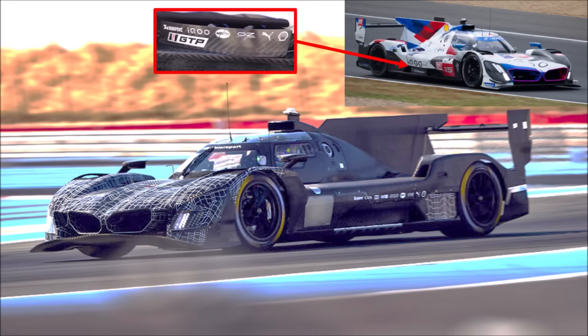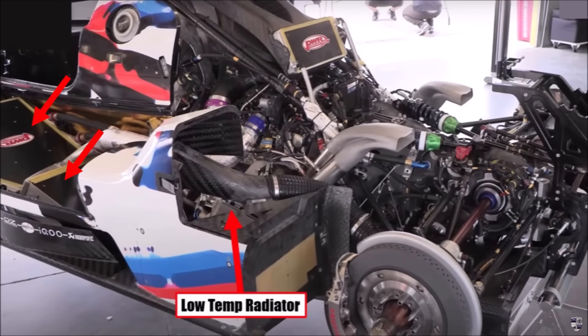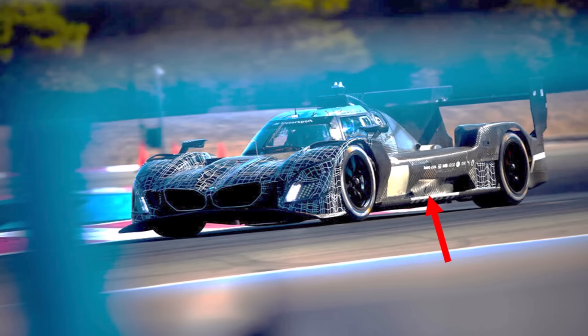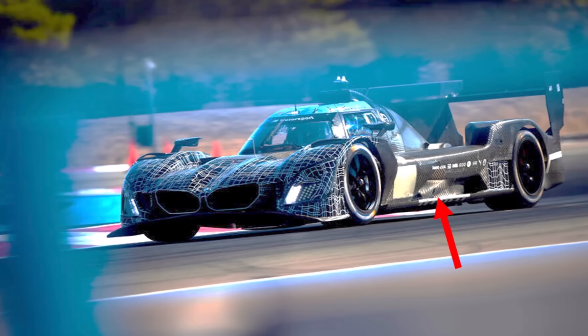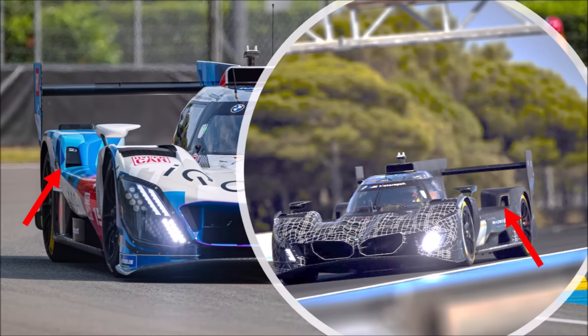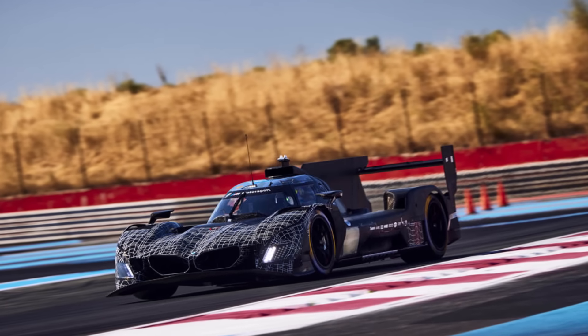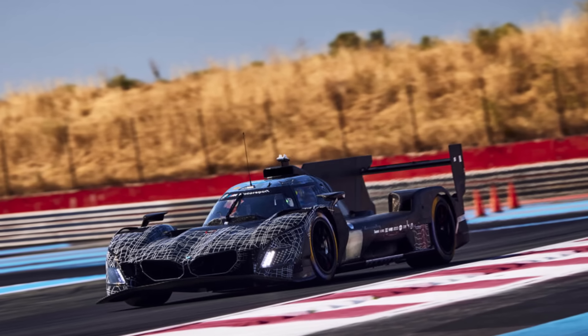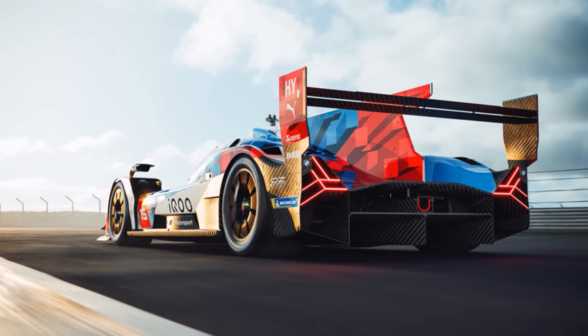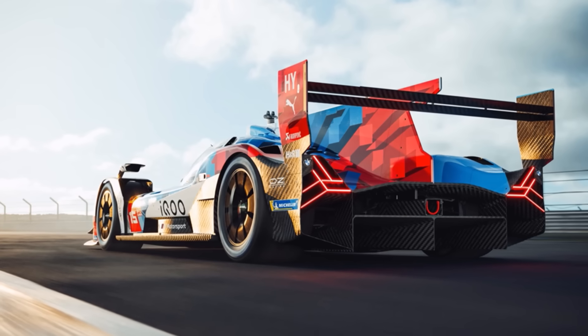A bit further back we see a change to their side pod. The large air guide is gone and there is a clear view on the inlet for the rear low temperature radiator. The BMW has a quite large and conservative cooling package with three radiators behind each other, which might be the result of the rush the car was originally designed in. At one point we could also see a panel which seems to channel more air to the intercooler. The rear brake cooling inlet stayed the same, although it is mostly blanked when the BMWs are racing. BMW says the aero update is also improving cooling, which could have to do with the front wing flaps which are hidden and could provide cleaner flow to the side pods.